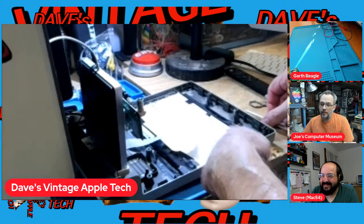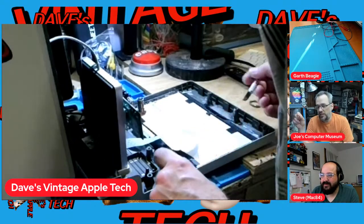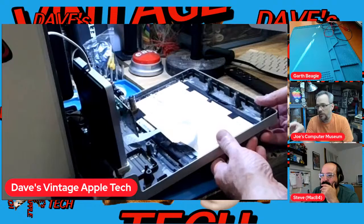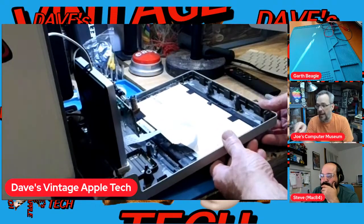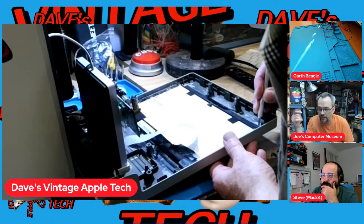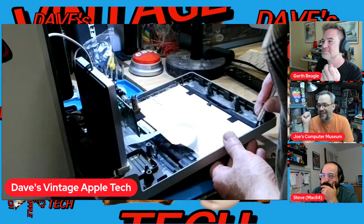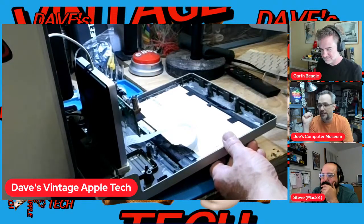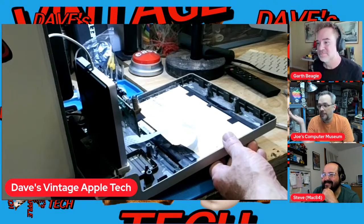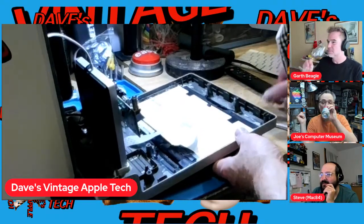Long story short, he, in combination with a bunch of awesome other people, figured out a process to use a specific type of SATA PCI card, with an updated chip and firmware on it, that will work in a PCI Power Mac, but make it look like a SCSI device, because SATA is technically SCSI at a very low level. And so you just throw drives at it, and it's like, oh, you want this 500 megabyte per second SSD in your old computer from 1992? The CPU will not know what to do with that much data. Everything is instant. Now I have to talk to him because every Mac under the sun is in my basement.